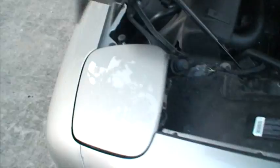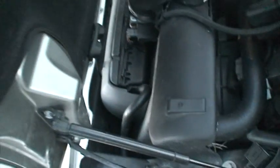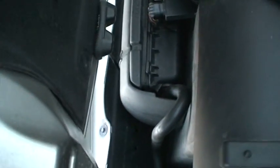What I decided to do is, like the Z06 sort of, I cut a little hole, as you can see right there, and the air finds its way through there. Within the airbox, there's actually quite a few baffles, little fins within the construction itself, that I had to cut out and smooth out with a woodworking tool, and that really helped. I put in a K&N air filter. That was the only real cost in that piece.